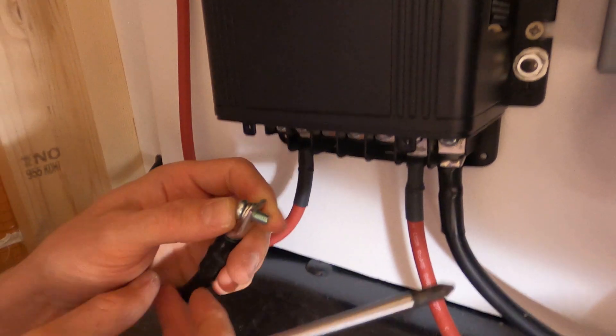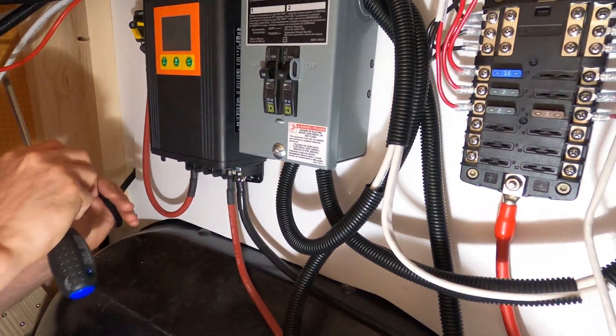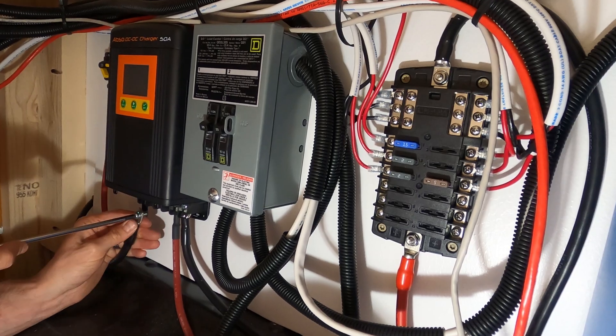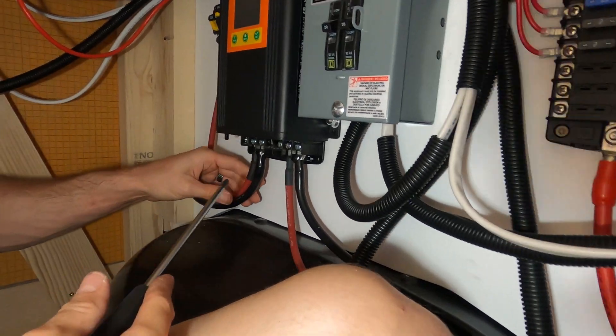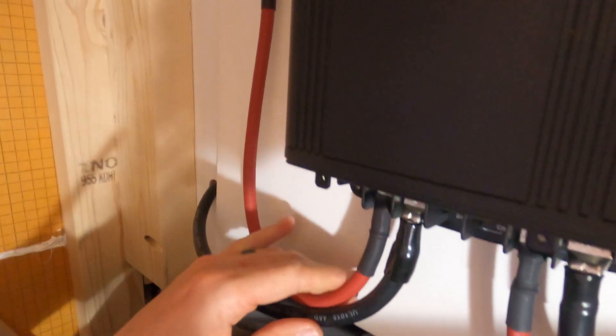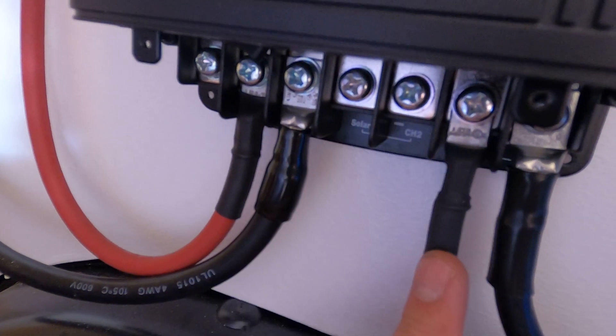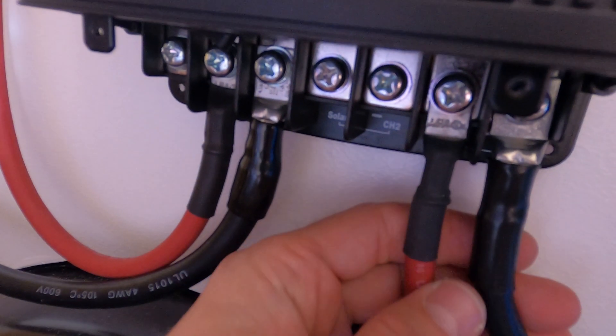Here's where I've ground the paint down on the body panel, so now I can connect from the negative of the battery input to right here — I don't have to run a wire all the way back to the battery. Now we've got all the other wood panels on. This is the last connection that we have to make it operational. I don't have the solar hooked up yet, but I'll be adding that soon. Now we've got the positive and the minus hooked up for the battery.